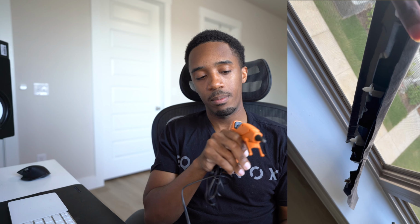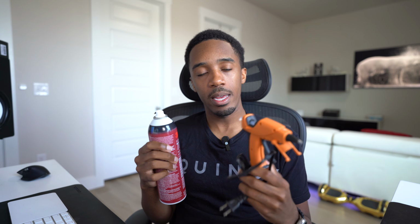Once everything is laid down on a headliner or the pillars, when you have those edges that you didn't get too much glue on and they're not sticking down, this is very useful in putting some hot glue down, sticking the edges down, giving it a few seconds to dry. This made things super easy. I do recommend getting a hot glue gun. If you do really good with your gluing, you won't need it, but there were times where the edges didn't get enough glue and they weren't sticking as much as I would like.